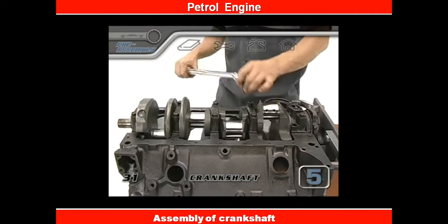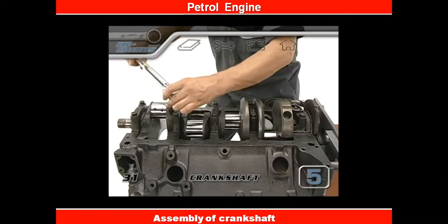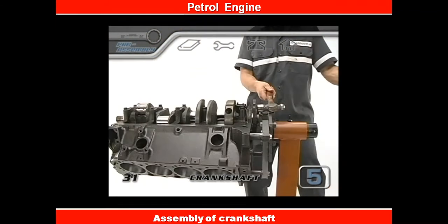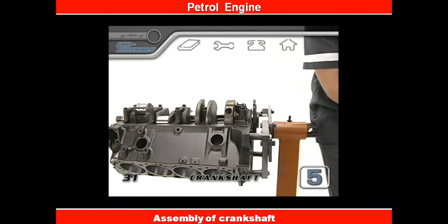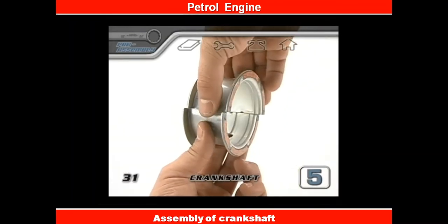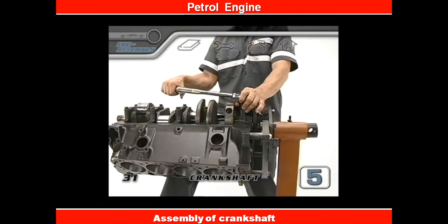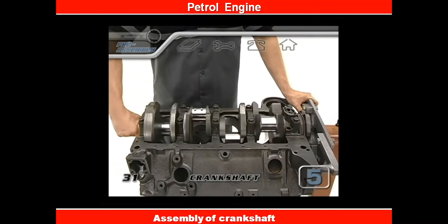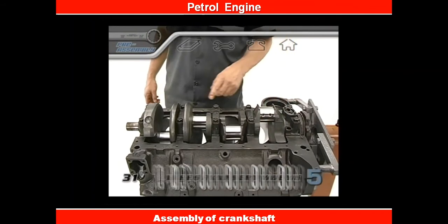This time around, torquing the caps is a much quicker process now that you can just spin the crank throws out of your way. Torque all of the regular main caps first — whichever cap has the thrust bearings in it will get torqued last. When you get to the cap with the thrust bearing, before you torque it, you need to seat the bearing. Lay a hammer or a block of wood against the crank flange on the back and smack it with another hammer. Never directly hammer on a crank. The force of striking the crank will line up the lower and upper thrust bearing shells. Now you can torque the cap that has the thrust bearings in it. When all the caps are torqued, the crank should be very easy to turn by hand — you shouldn't feel any binding or tight spots.